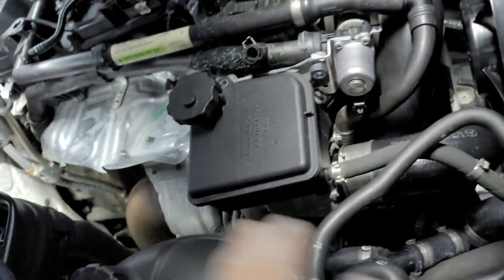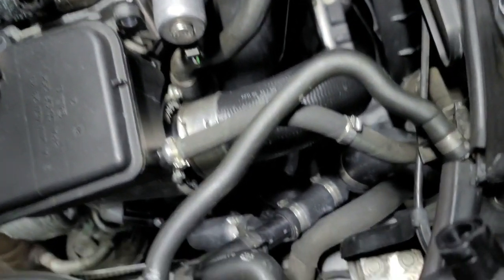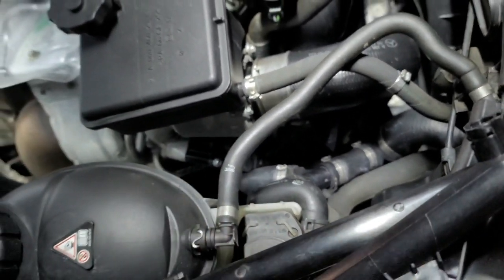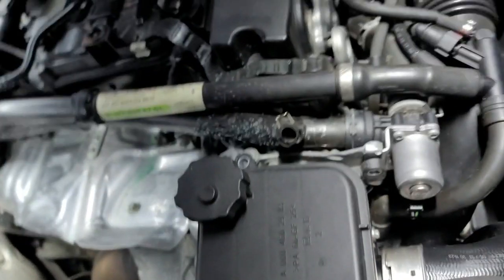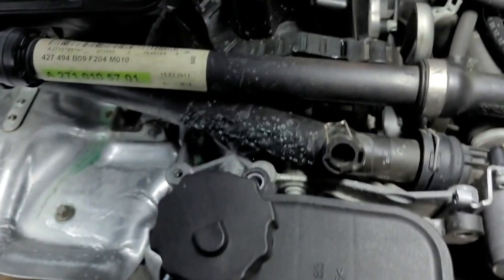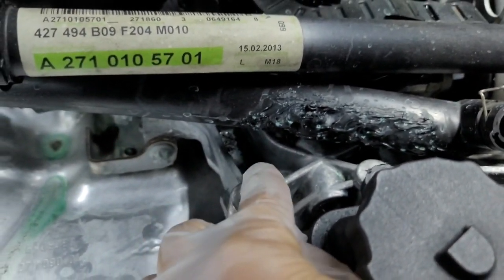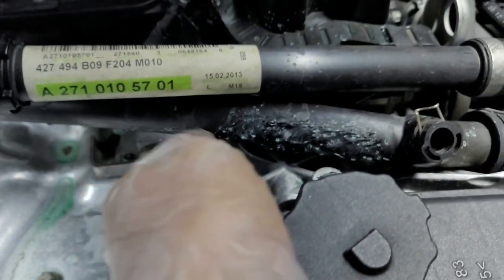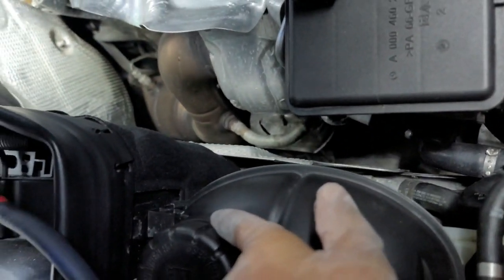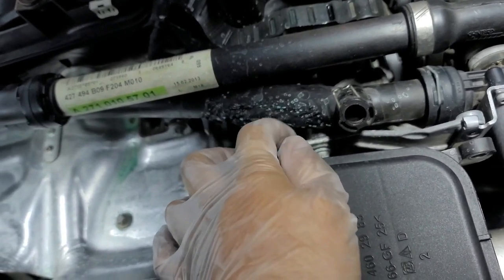The cap was an issue and the upper radiator hose was an issue, but it's new now so I don't have to worry about it - these usually wear out over time. One day I kept checking under my hood, pulled over, and noticed there was a crack here because it was spewing liquid. I noticed liquid but wasn't sure if it was cracking from here or spewing up from the coolant reservoir. Eventually I noticed it started leaking from here and I heard bubbling noises.